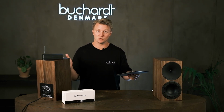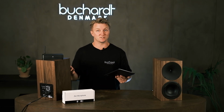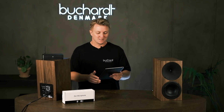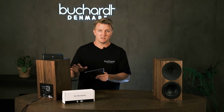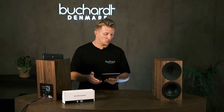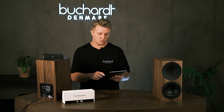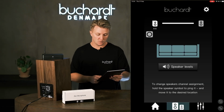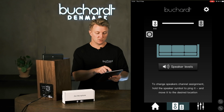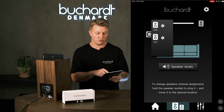So if you start playing music now, you will just have left channel playing out of both of them, and that will not sound very good. So we need to arrange one of the channels to your right, and you can do that in two different ways. The easy way I found is of course to use the Buchardt app, and we go into the speaker setup tab right here, and you can see you have two speakers on top of each other. You just press and you will have both of them.